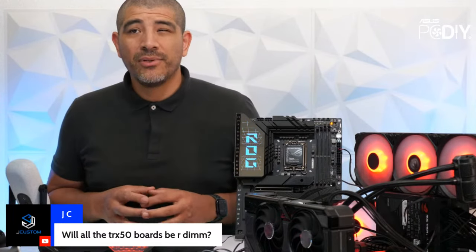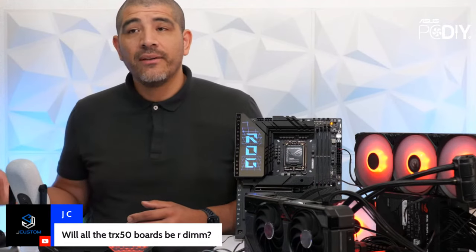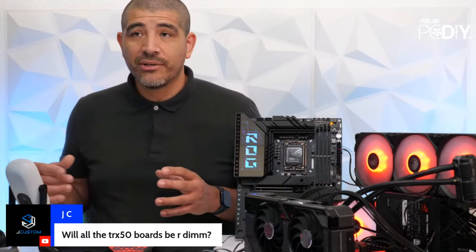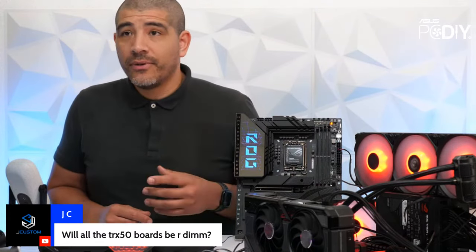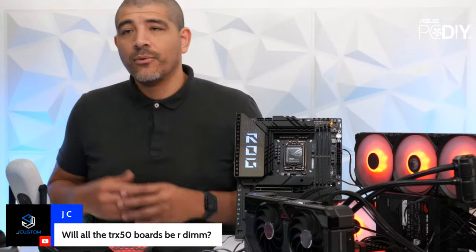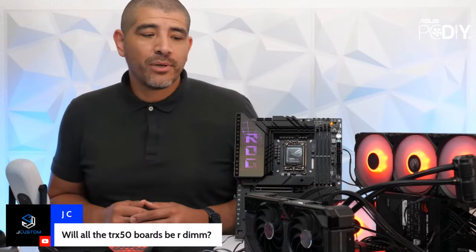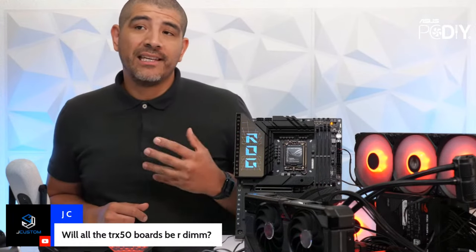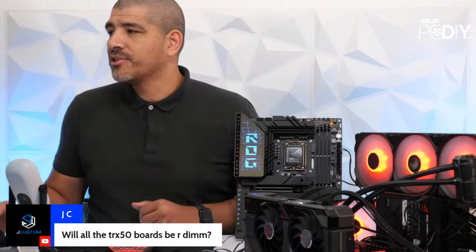And also keep in mind that when you go to higher memory channels, even though you will be having overclocking DRAM support, it's going to be more stressful anytime you run higher memory channels and also higher density. So if you care about bandwidth and frequency and you really like DRAM overclocking, that is going to be possible on here. We'll talk a bit more about that once the performance embargo lifts, but you still would probably want to be focusing on the mainstream platforms where, of course, there are fewer memory channels. With fewer memory channels, you can scale to higher levels, right?